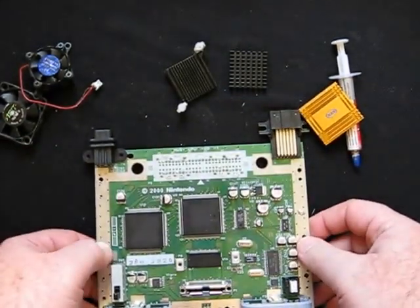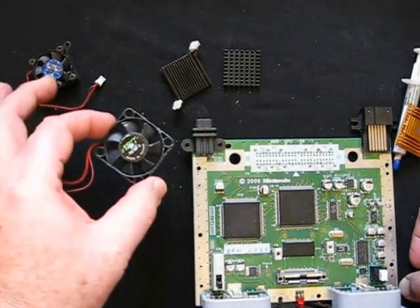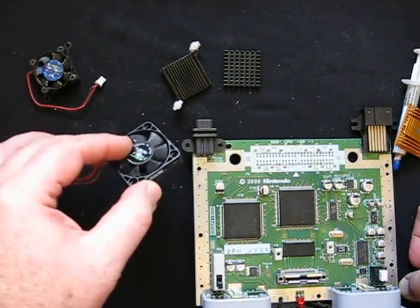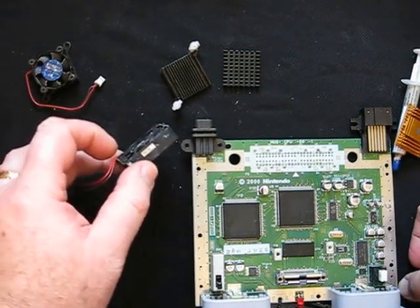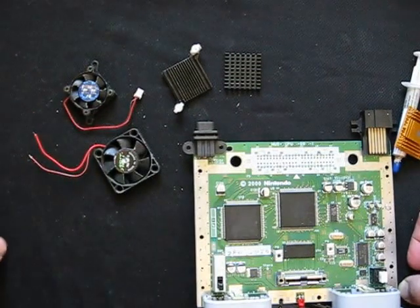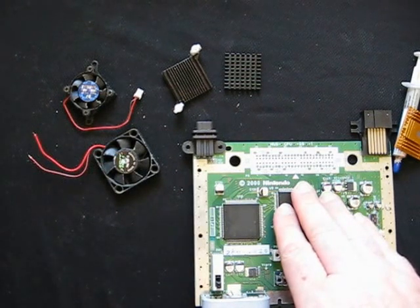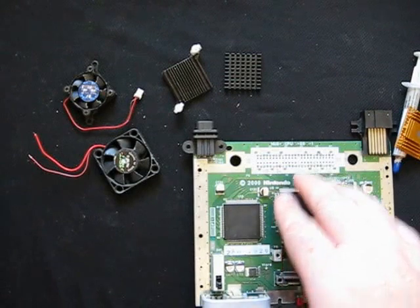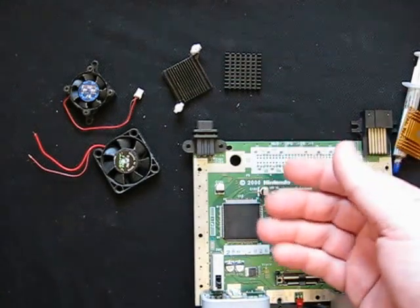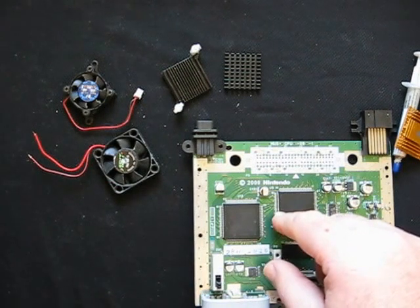You also need cooling because there's no point having a heat sink if warm air can't escape. A normal style fan is absolutely adequate — they come as either 5 volts or 12 volts, and some can be nice and thin while others are thicker and different sizes. Given the low heat that systems like the N64 generate, any fan will do the job fine. Make sure there's space in the top of your system for air to release — warm air rises and cold air drops, so some small ventilation holes allow warm air to escape very easily.